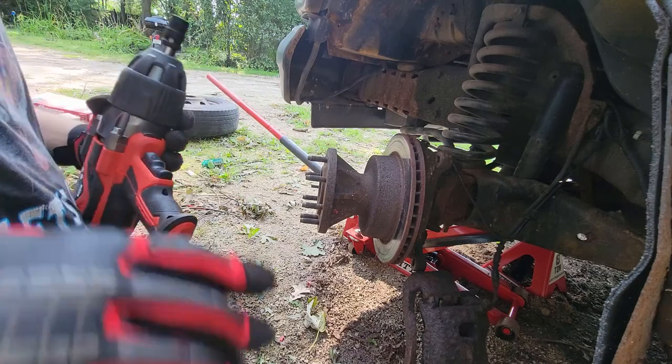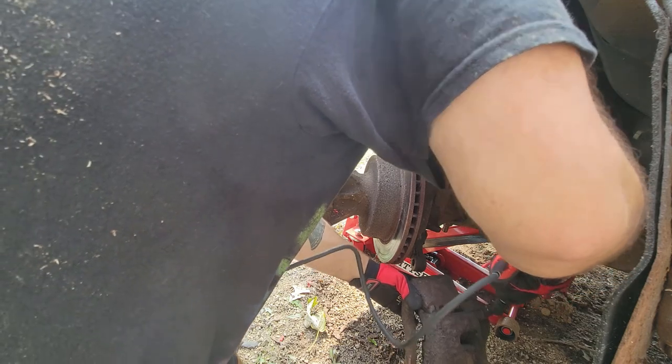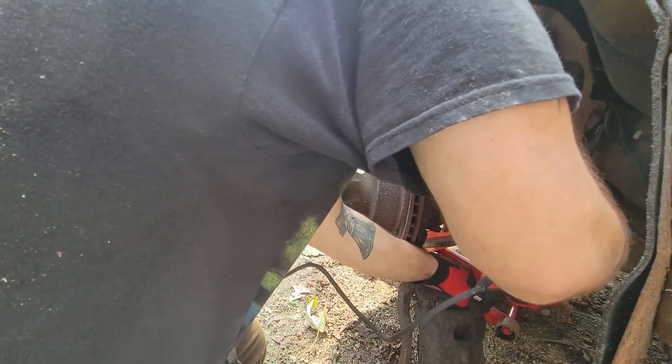What I'm doing here right now is taking the third bolt off. After I remove the caliper, there is a third bolt that holds the tube that goes to the caliper — that's where the brake fluid comes in. I have to pop that off because I'm just going to be replacing the whole caliper and rotor.